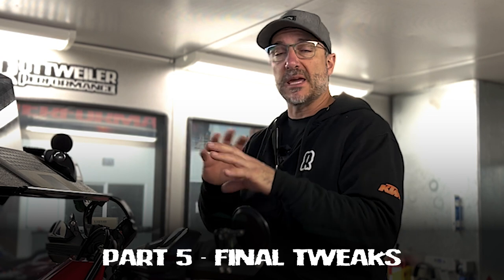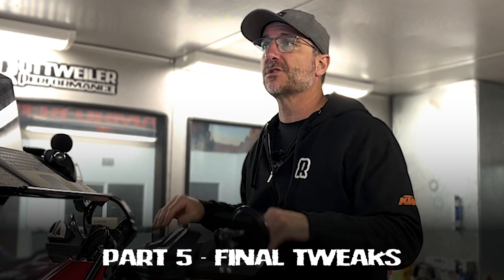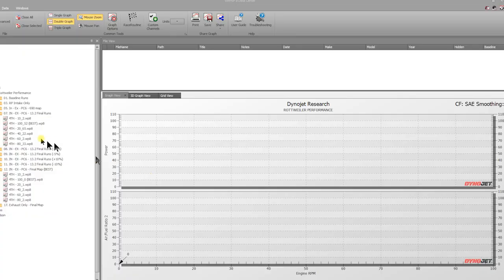All right, in this section, we're going to show you exactly what happens when we start making tweaks to that 13.2 map that we built. So that's our first target. That's pretty much what you shoot for. Then what we do is, if you look here on the screen, we've got some folders. We're not going to get into them, but we do the same runs, and we'll tweak those runs 5% leaner, 5% richer, 10% leaner, 10% richer. And then we'll try to identify exactly where this bike likes some of those enrichments and enleanments better. And sometimes, like maybe from 6,000 RPM up till redline, it does like it richer, 5 or 10% richer, but it doesn't really care anywhere else. It's all the same everywhere else.